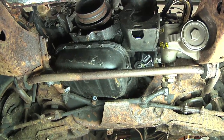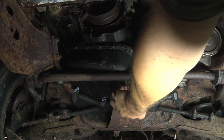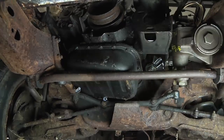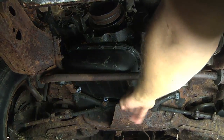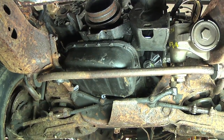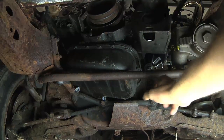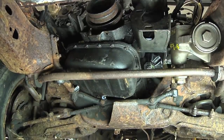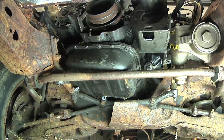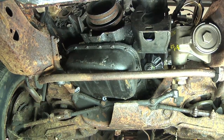The other thing to be careful of is right back here — the actual steering itself — because I do need that whole oil pan to clear that, and the little road debris guard thingamajigger here. I do need that to be in front of all of that, because you still got to steer. But I think maybe without the torsion bar and taking that AC bracket off, I'd probably be able to lower in the engine and get it exactly where I want it to go, and then figure out how to do those engine mounts.